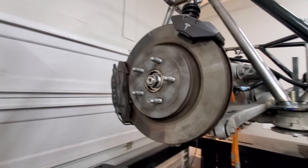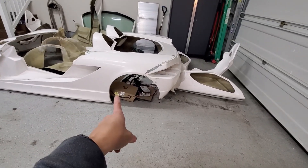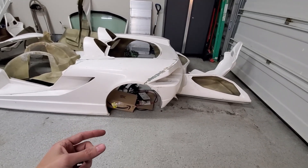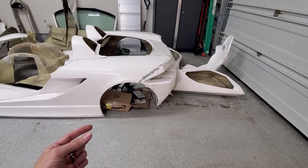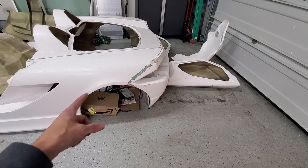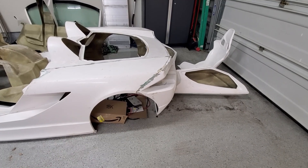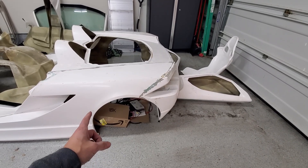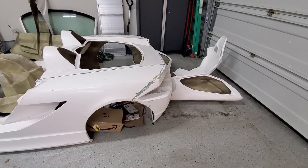What that means is for the rear, to get the kind of tire I want, I'm going to have to do a couple things. If I want something like an 11-wide, the widest I can get right now is about a 9 or even an 8 with a pretty large offset, because otherwise the wheels poke out quite a bit. With such a tight gap around that, I would need to either not hit any bumps or essentially widen the wheel well there. So I am planning to bring it out a little bit and maybe give just a titch more room so I can get more tire.